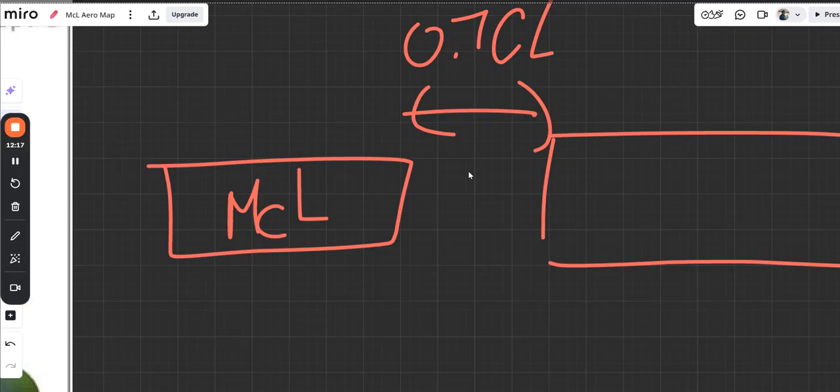One more piece of evidence of this is to look back at the sprint in China. Piastri was following Max for quite a majority of the race, and he was in DRS for most of the time. When he finally overtook Max, it's not like the Ferrari was the fastest car out there, but it's because he had not cooled his tires enough. Because he was in the DRS, he did not have enough flow through the brake duct to cool his tire enough. He had a lot of tire degradation, and we know he's got much better at his tire prep abilities as well. So we can't question that, oh, he's just a bad tire saver.